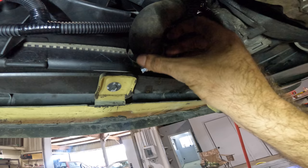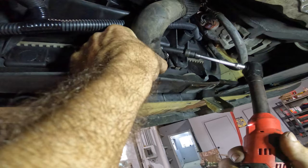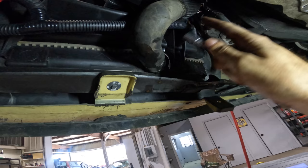All right, we've got this lower hose clamp to get on. There, let's move the light. Now we can see what's going on here. I did replace this clamp because the other one came apart. And then I've got two bolts to secure the bottom side of the fan. Click. Okay, two more bolts down here and then we'll grab those two up top. Remember, I left them loose so I can maneuver this thing around.